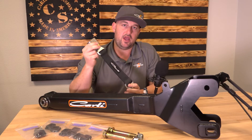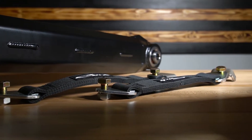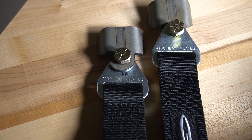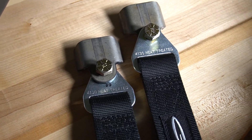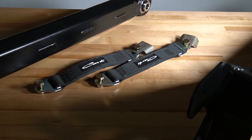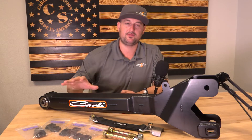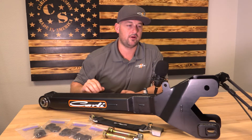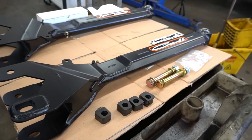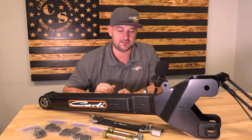These are a US-made quad wrap limit strap. The buckles on the ends are 4130 heat-treated chromoly, and additionally we supply you with grade 8 hardware as well as a mounting clevis to weld to the frame. Turning this into also a bit of an unboxing video, since these new arms do come with quite a bit more hardware — you'll notice that you also get two arms, not just the one you're seeing here. A mirrored version thanks to that tire pocket cutout, limit strap tabs, and other side-specific features on this arm.